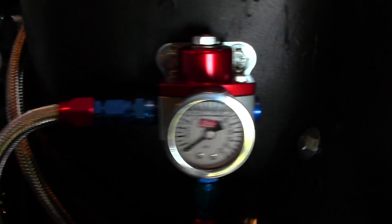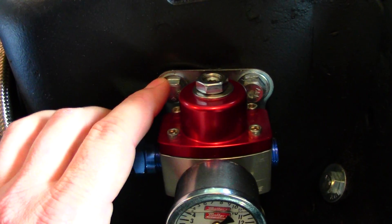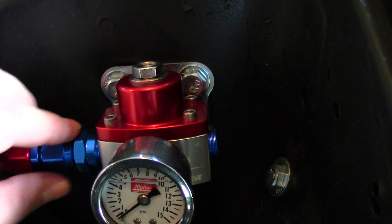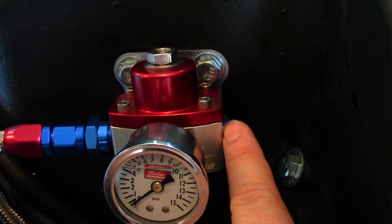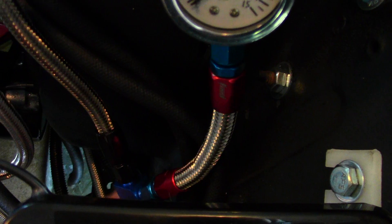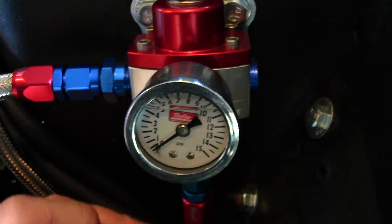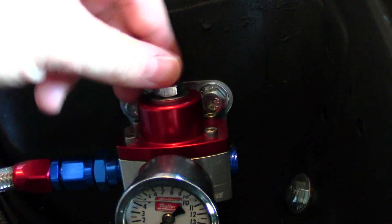This is basically just an Aeromotive fuel pressure regulator — it's all aluminum and it is made in the USA. These are not cheap by any stretch of the imagination; this is about $90 to $95 at the local speed shop. What you can see here is it's got dual outlets, so if you were running a twin carburetor setup you could actually run another line out and make sure it's also getting regulated pressure. This is where the fuel comes in — this would connect to the pump. I have mine coming out of the pump, one goes over to the nitrous side and one goes over to the main fuel. Your fuel inlet is here and your fuel outlet is here.